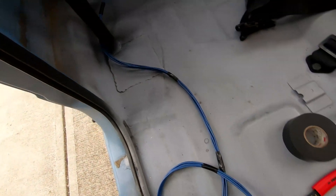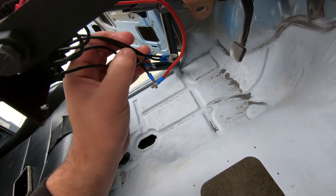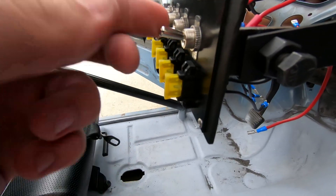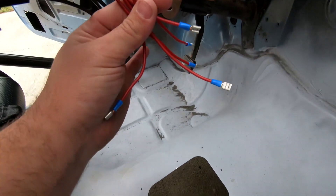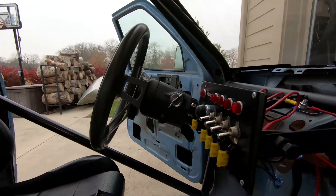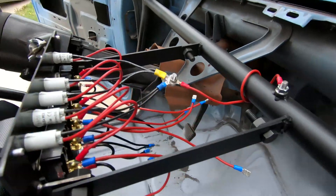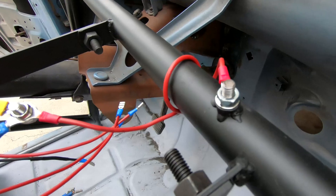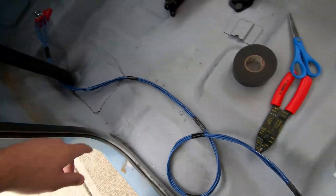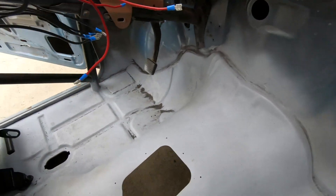We got it bolted down, wires coming off all taped up — looking a little better now. Those wires run up to the control panel. The blue connectors tie into the bottom black lines, which go into the fuses, the fuses jump up into the switch, and the switches go into the red lines. Some red lines go back to the relay board and some stay out — like the ECU power-on wire, which will probably stay. The indicator lights up top are jumpered into the switch through a little red wire and go back to the cage ground, so it'll be a neat little functional board.